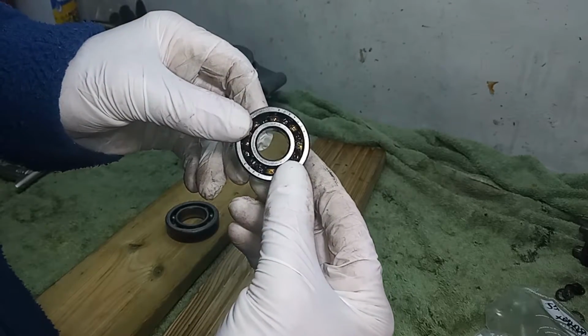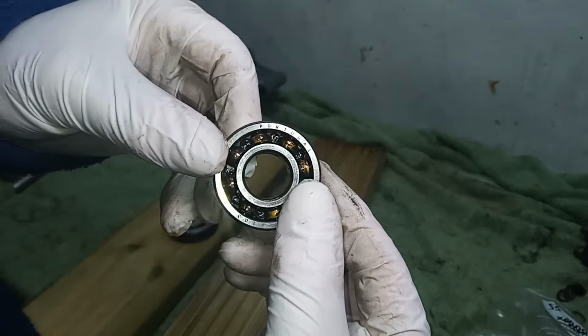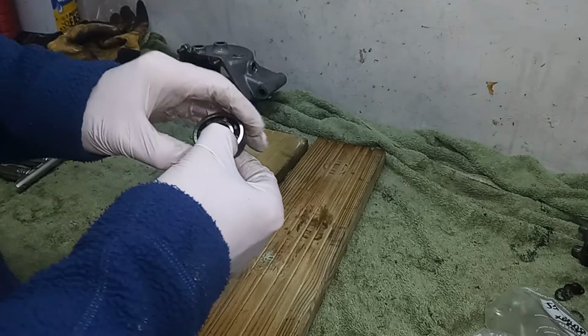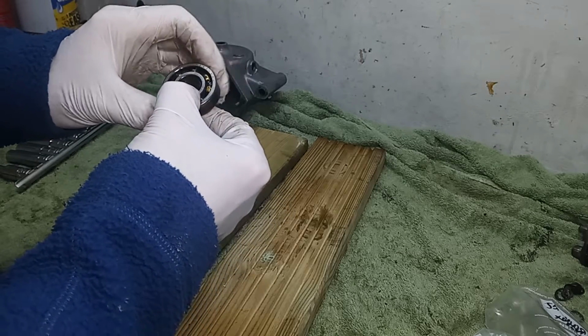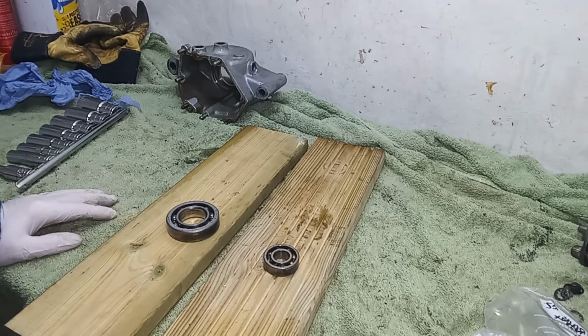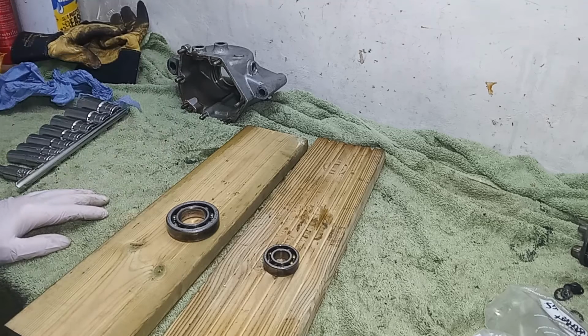You can probably read the name there, where it says Portugal. So these allegedly were the weak bearings on the layshaft that would break up. And the trouble is, if your layshaft jams, that jams the main shaft, jams the whole gearbox, and that means it's after the clutch, so the back wheel will lock up.